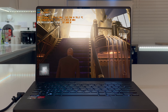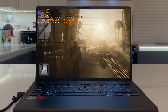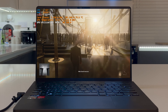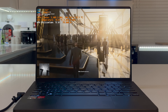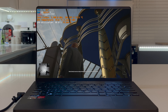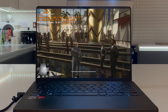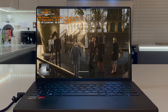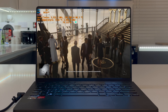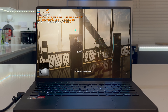I've already shown in a YouTube Shorts video just how well this device can do on a tiny power budget over USB-C. It can run Cyberpunk 2077 on high settings at 75 frames per second sharing just 75 watts between the CPU and the GPU. So there's no reason why we can't go into Armory Crate into custom mode and give it a 10-watt haircut. By doing this the temperatures come down by about 10 degrees and the performance is exactly the same, but the keyboard deck, the areas around the keys, and the palm rest will no longer get so hot that you'll be uncomfortable.